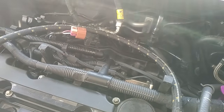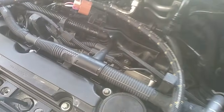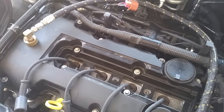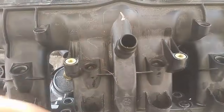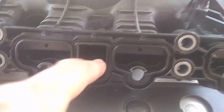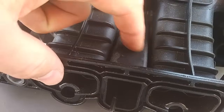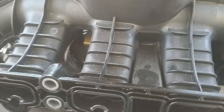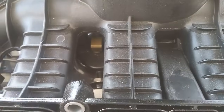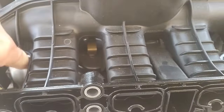The other option is a PCV fix kit that I designed a little over a year ago, which basically reroutes the PCV gas externally underneath the intake manifold. My kit is $85. It includes some hardware to plug up the hole inside the intake manifold. You run a screwdriver through it to plug up that hole, then drill a hole right here with a step bit. You run a few fittings together out through a check valve that sits right here. That check valve is heavily overbuilt — designed to withstand like 400 PSI when your engine only produces between 16 and 24, depending on your modifications — so it should last the entire life of the car.